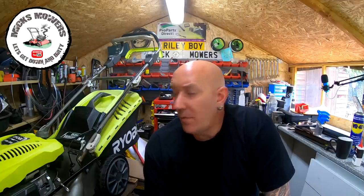Okay, so that'll do for this little lawnmower for part one. I'm going to do a part two on it. The video will be too long, so look out for part two. But this lawnmower is running, to a fashion. It's a bit smoky, admittedly. It's got a bit of a fuel leak, and the dead man's handle switch is not cutting the engine out, and it needs to before it can sell. So I need to have a look at that, see what's going on with that.